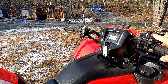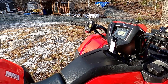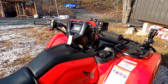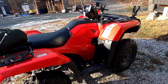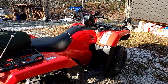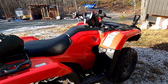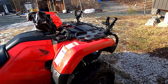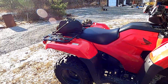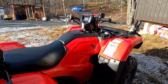Push-button four-wheel drive is pretty nice to have. Once you have four-wheel drive activated, you can put the posi-traction on, which locks the differentials, allowing a little more grip but in a straight line. This is predominantly used for plowing and tasks that don't require high performance, since steering is limited with that function activated. Most of the time I drive in two-wheel drive for fuel consumption.